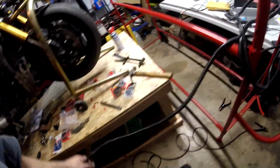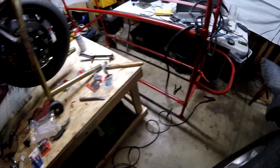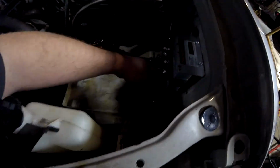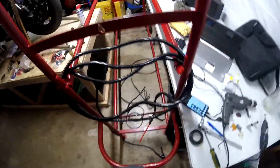Guys, what I got here is 18 feet of the protectant along with a 20-foot section of this 4-gauge wire that was cut out of some jumper cables. Here's the negative side that I'll save and use for later. I took a little bit of that red piece off there. I guess if you wanted to be super professional, you would take some of that black and put it there. But it's all hard bolted there and physically can't move, and it's on plastic, so I'm not going to bother. But if that's what you want to do, that's cool. Criticize me, whatnot.